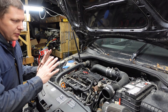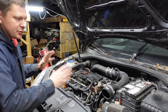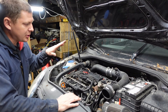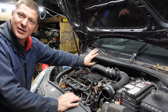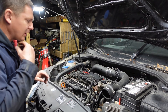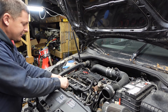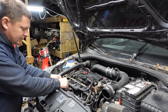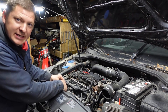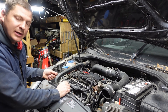Because this thing has had a bad PCV and these other air leaks for so long, the ECU has really adapted to that. It's compensated so much trying to make the mixture correct on the exhaust side that it's hiding the fact that the PCV is bad. What I want to show you: I'm going to pull the dipstick out — hopefully you can hear that hiss of air, because there's a lot of vacuum in the crankcase right now.